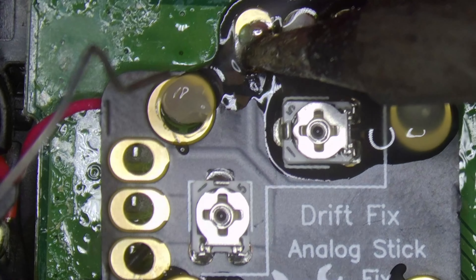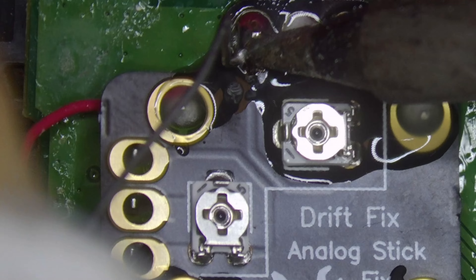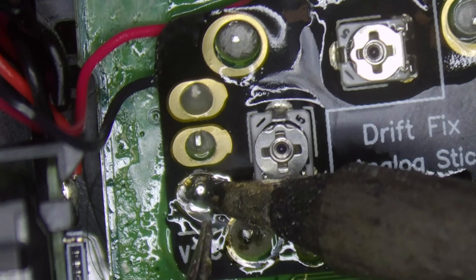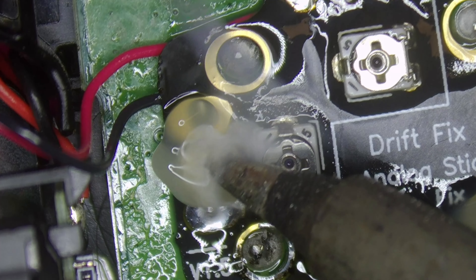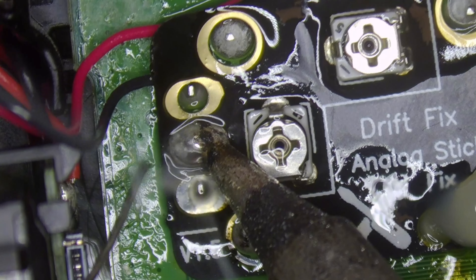These things come in handy especially when you're on a budget. It's really simple to use and super cheap — I picked these up for about $5 each. It's a much better alternative than buying a new controller, and I'll go ahead and leave a link in the description on where you can find these handle rockers. We're going to add solder to each contact point. Right now I'm soldering the potentiometer pins, and once I'm done with that I'll go ahead and solder on the legs.